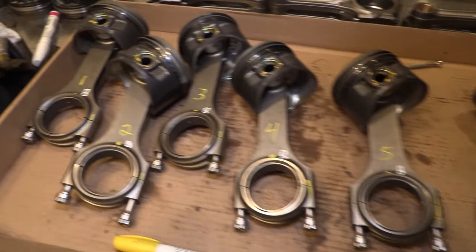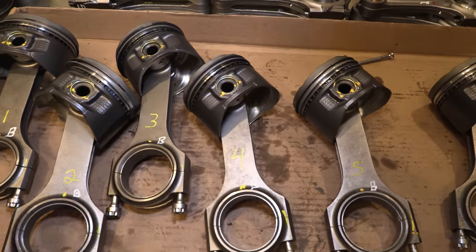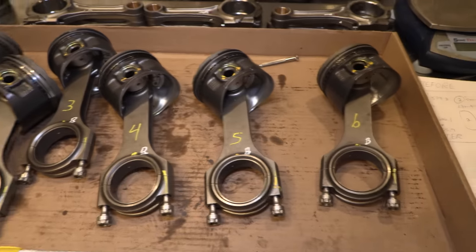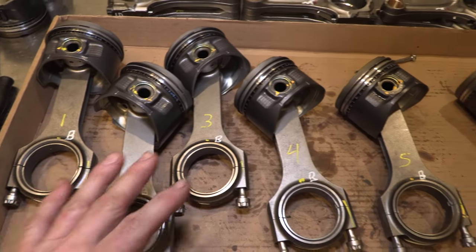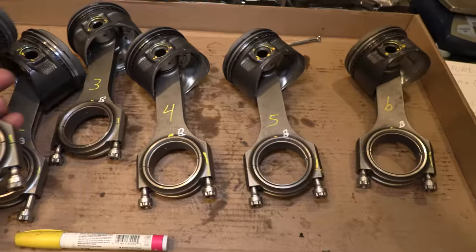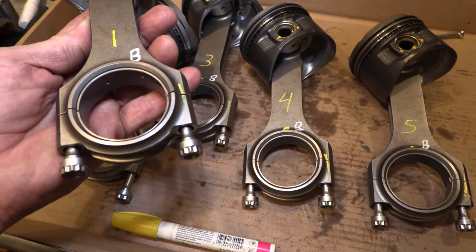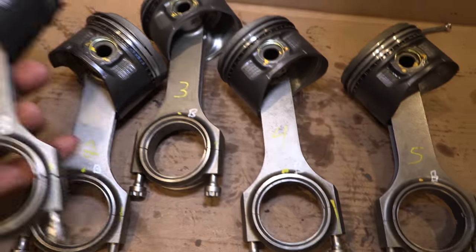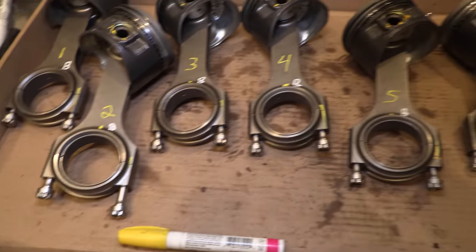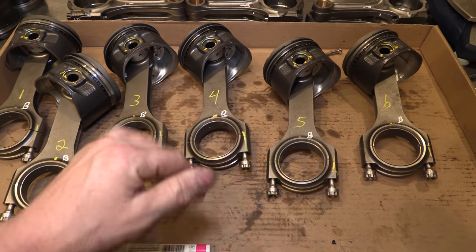I'm finally done mix-matching connecting rod bolts and assembling the connecting rod piston assemblies. I just wanted to clarify: this is static balancing, not dynamic balancing — dynamic balancing is something totally different. This is an inline six for the Toyota Supra, and in the Supra this makes a big difference to make sure all these weigh the same. That's also why when you get a connecting rod set that's been match balanced, they tell you not to switch up the connecting rod bolts — each bolt can differ by like two tenths of a gram. I used that to get my numbers closer together, just by removing material on one, mix-matching the pistons and the rod bolts.